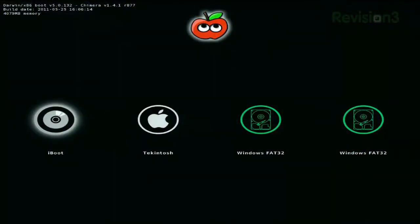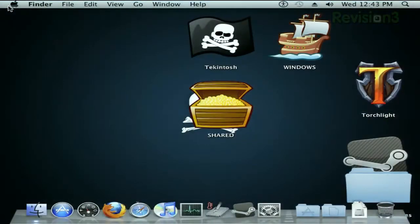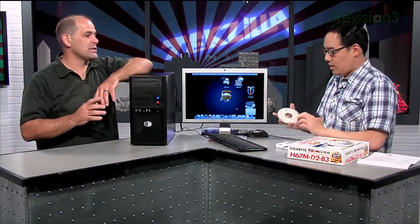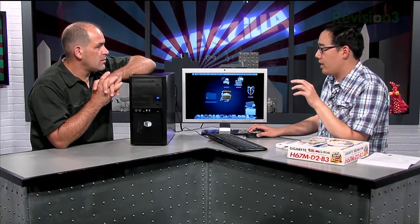As you can see on the screen, I have iBoot — the Mac partition — and two partitions on the second hard drive, which eventually I might put Windows on. I just rebooted because going through the iBoot process takes a long time. Once you do it, you install it as you would normal OS X. The iBoot process is only for the initial installation, not every time you reboot. Once you reboot after installing OS X, you still actually have to boot with the iBoot one more time.